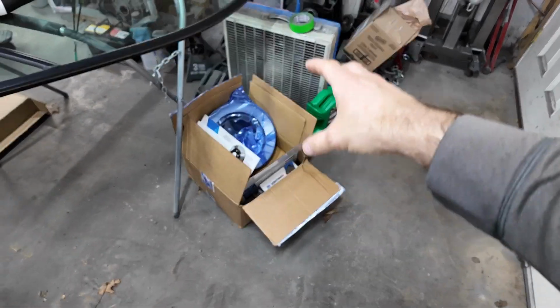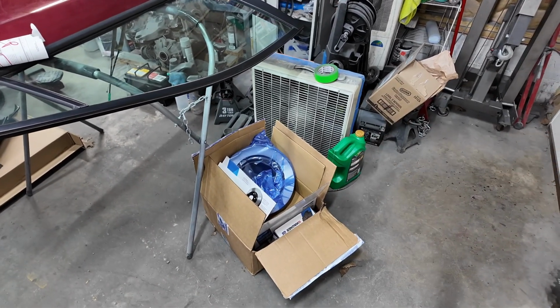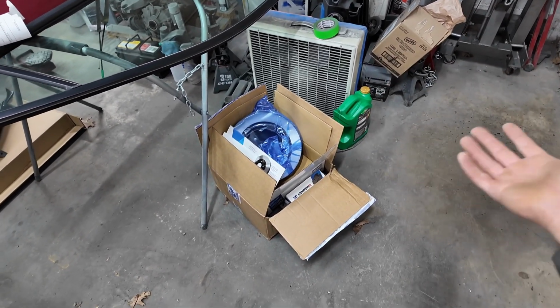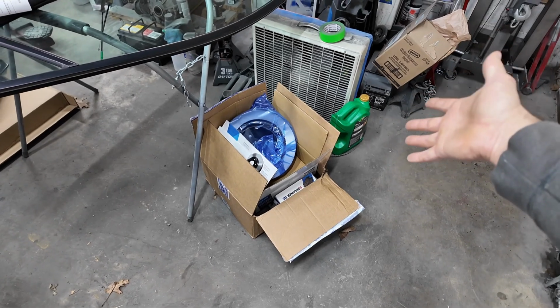The brakes that were on my truck are some sort of brand that says Extreme something. They're drilled and slotted. I had to replace the fronts. The outside pads were brand new. The inside pads wore down to metal. Took them apart. The sliders were good. Everything was good in there. Just wore the back pads out.